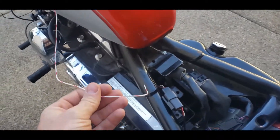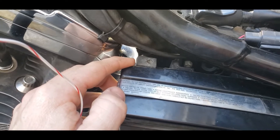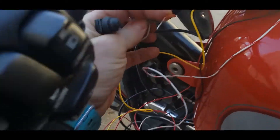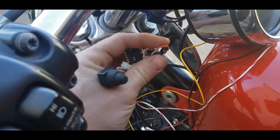To do that, there is none coming off the battery or off the bike, so I'm gonna have to build a little fuse terminal coming off the positive of the battery. That's not a problem. The red is gonna go into the stock speedometer harness — it's gonna go into the orange/white.